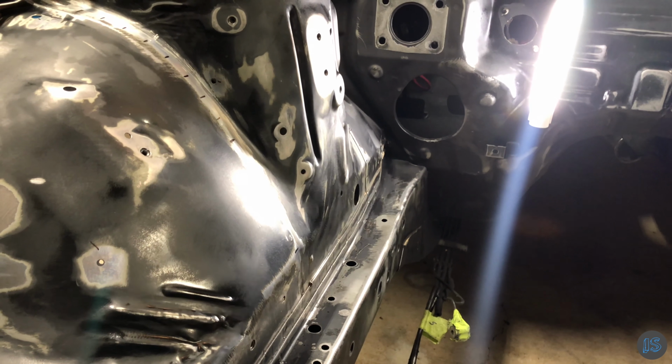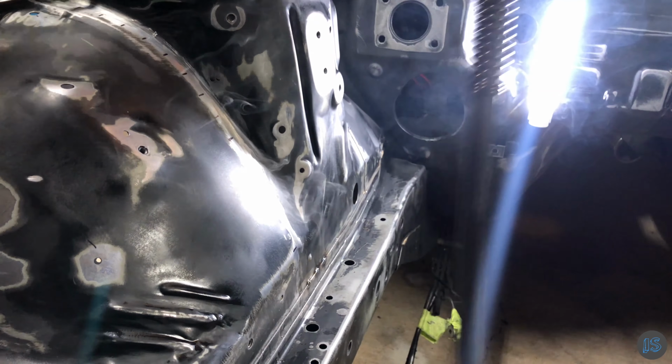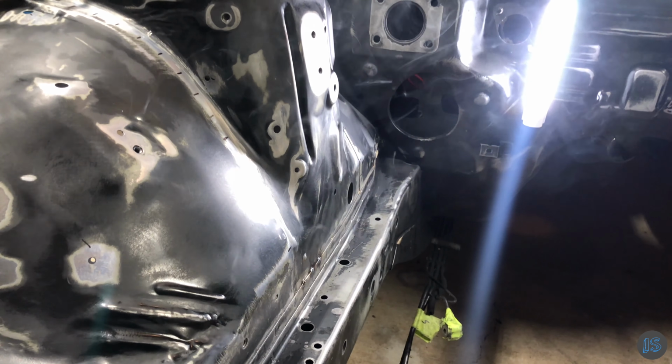The first thing I do when I start to weld is focus on the heat I'm putting in. I find an area that's not as critical and it's easy to reach, and just set up a few tacks. Then I go with the setting I like the best. The idea is to have a good weld penetration and a nice flat tack. Thin sheet metal can kind of be tough sometimes though, so take your time and do your due diligence before getting to more critical areas.